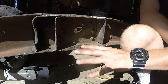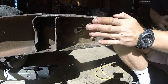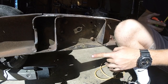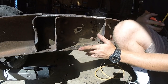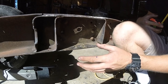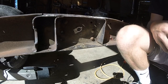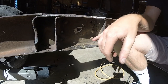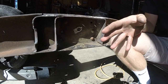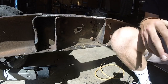From the inside of the frame rail wall to the other side is exactly 33 inches, and from the inside of the rail to the other side I measured 29 and a quarter inches. I'm going to use the 33 inches from wall to wall because it's a whole number - easier math. The dowel pins are 31 and a half, so I need to take three-quarters off of each side to give me that one and a half back.